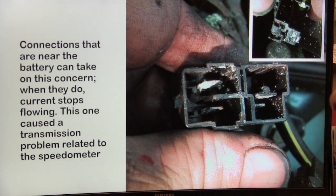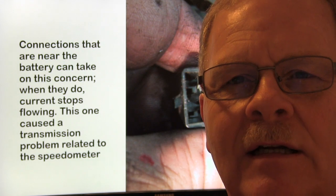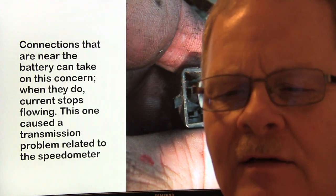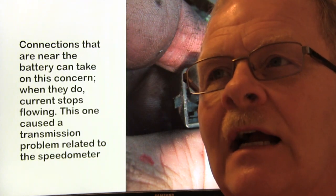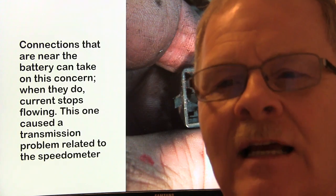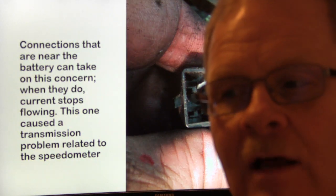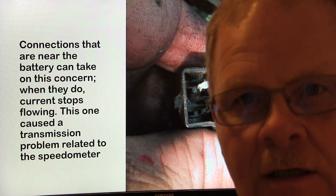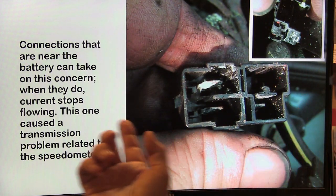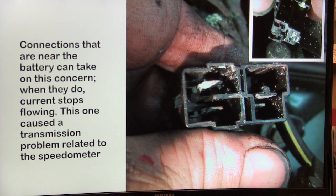These connections close to the battery — that one was not easy to spot. It manifested itself as a speedometer that wouldn't work and a transmission that wouldn't shift on a '97 Escort. Somebody had already put a vehicle speed sensor on it and it didn't fix it. I didn't have communication with my scan tool. It turned out pin 16 is your power at your DLC, pins 4 and 5 are ground — one of them didn't have ground. When I tracked it back, that same ground at the battery fed the vehicle speed sensor and the DLC under the dash. That's why the transmission wouldn't shift, the speedometer didn't work, and the scan tool wouldn't talk. I clipped out the chalky garbage, put wires in there, soldered, heat-shrank them, and that was that.